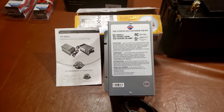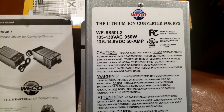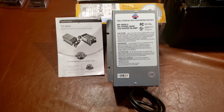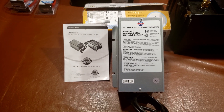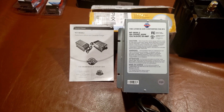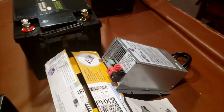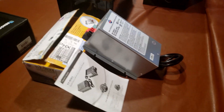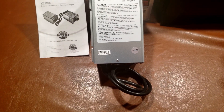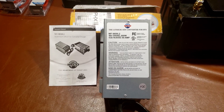Taking a closer look at the converter charger — this is the model I chose. It's very similar to the one already in the coach; this one's just made for lithium-ion batteries and not for lead acid. The reason I chose it is it's going to be a plug-and-play direct replacement for what's already in the coach — wire off, wire on, you're good to go. Same size, same footprint, going in the same place. No hassles, no worries.